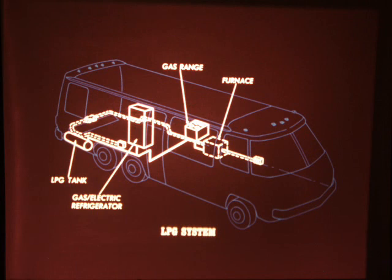The LP gas system is always supplied by the LPG tank — that's liquid petroleum gas — never by an outside connection. Butane or propane may be used; the choice is usually regional, since butane will not vaporize in cold weather, while propane will vaporize down to 40 below. LPG is gas under sufficient pressure to turn it into a liquid. The 26-foot model's LPG system is depicted in this drawing. On demand, it is drawn from the tank through a regulator valve and depressurized into a combustible gas.